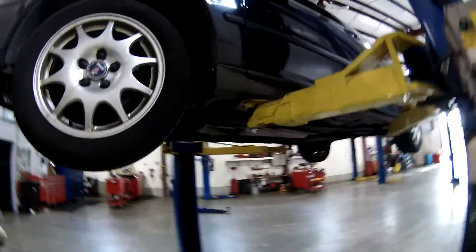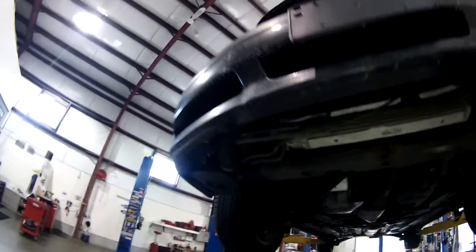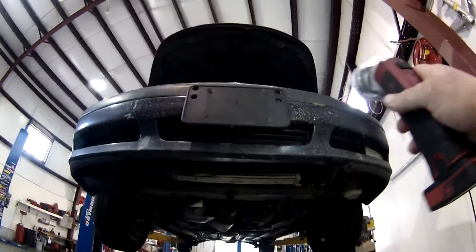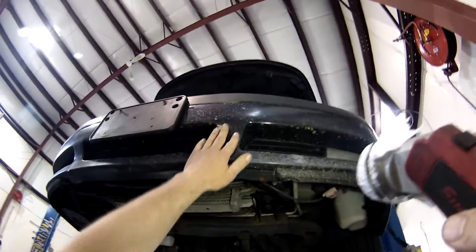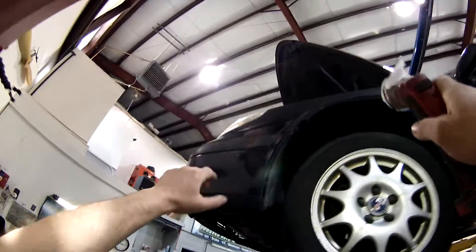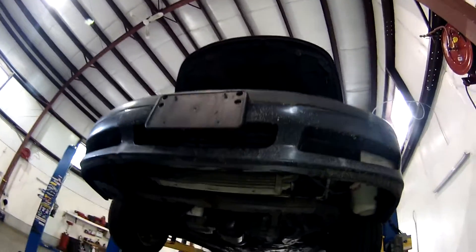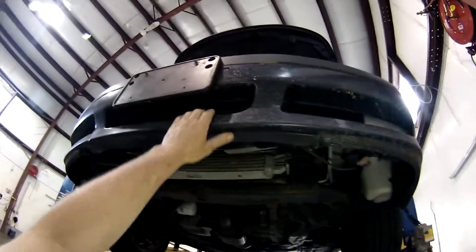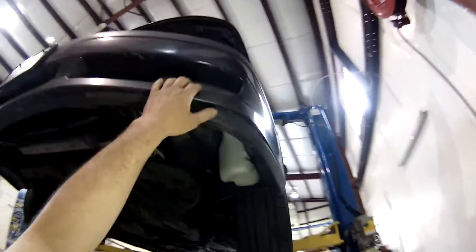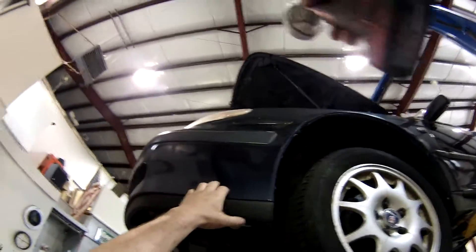I got you up here on the old head cam with my trusty filtered flashlight. Why don't we start at the front and work our way back. The first thing I noticed about this car is this front bumper and fender have a faded, chippy paint on it. I'm going to say this car had some front-left damage that was repaired some years ago, but they didn't use the correct clear coat or didn't do something right in the process.